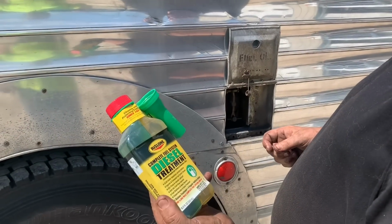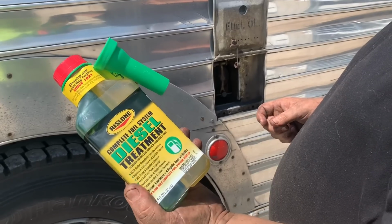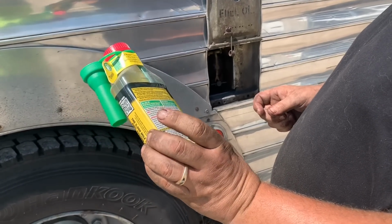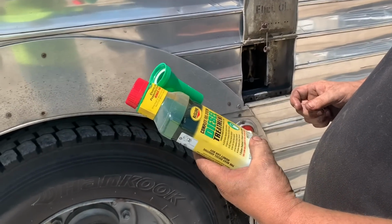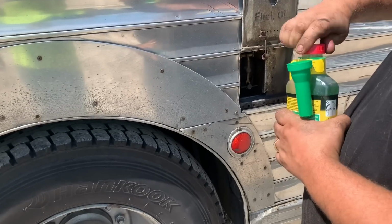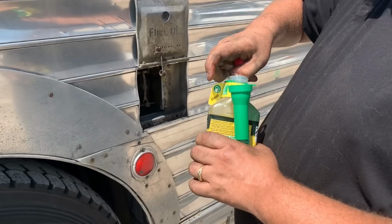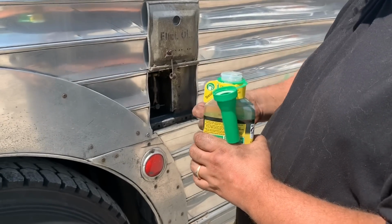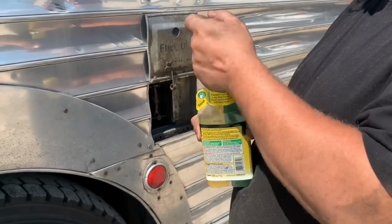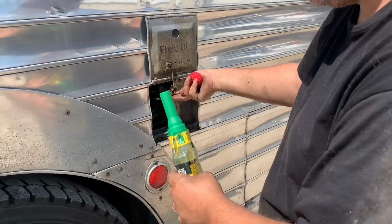So we're going to put the diesel treatment in here. Anything you want to say about it? It's good stuff. Good for cleaning the injectors, and the biggest thing, a little bit of cetane boost, it says. Yeah, with all our companies, whether it be Bars, Rislone, or Hy-per Lube, it's all about lubrication. And the biggest thing with injectors with low sulfur fuel now, you've got to have lubrication to keep those injectors lubed up, so that you're running at optimum power and capabilities of the motor.